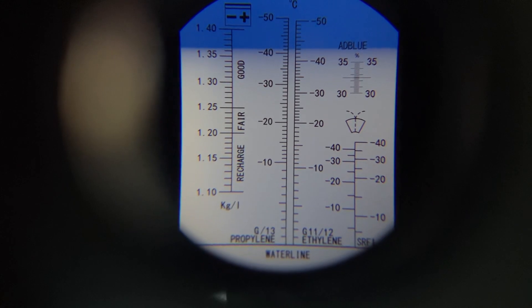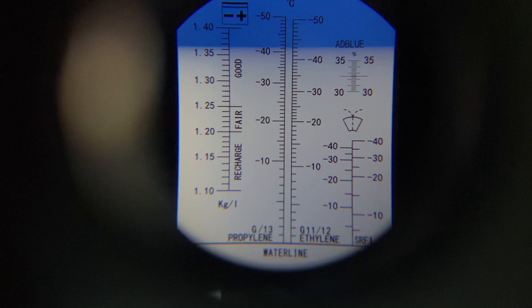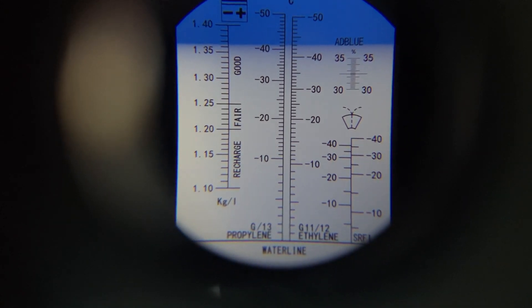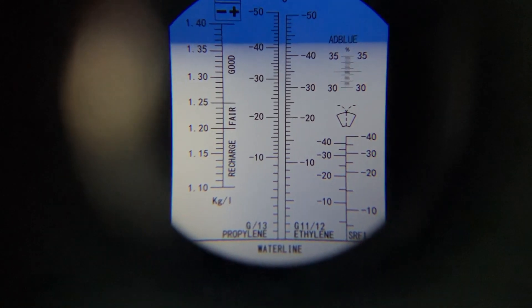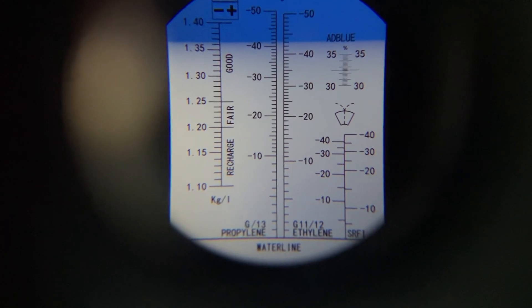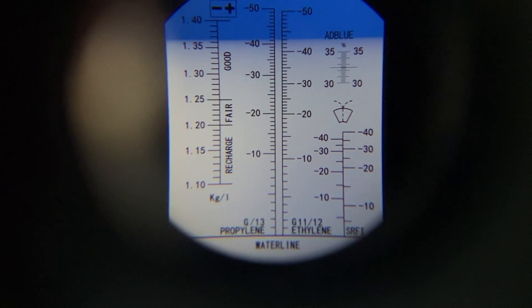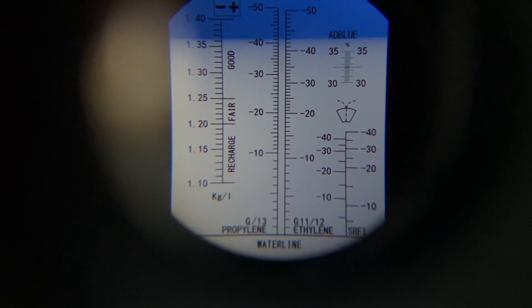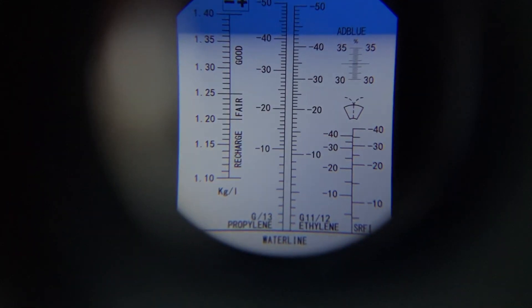For this particular car, minus 43 degrees centigrade is pretty high — there's a lot of anti-freeze protection, probably more than required really in the UK. You'd be looking at sort of minus 20 to minus 23. Normally if you haven't got any sample, the whole screen will just be blue, and as the water content is sampled it creates that blue-white divide, which is your reference point. Hope that makes sense, and please do like and subscribe if you're enjoying the videos — thanks again.